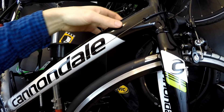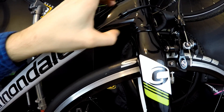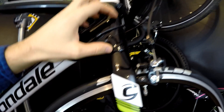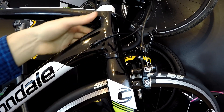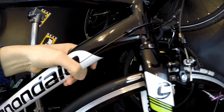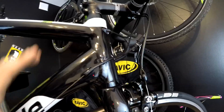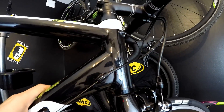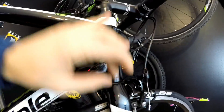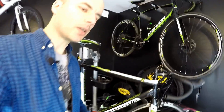Now let's look at the connection between the main tube and the head tube. The shape of this tube here is completely different — it's much wider here in order to give a very strong connection between the head tube and this down tube. This oversized main tube and great shaping just wouldn't be possible without hydroforming. The head tube itself is also hydroformed — we can see different shaping where the bearings are, and there is also a different size for the upper and lower bearing.